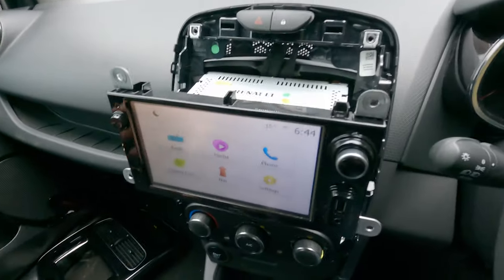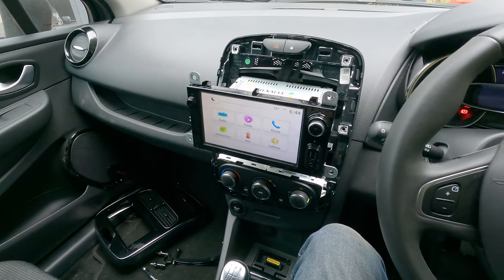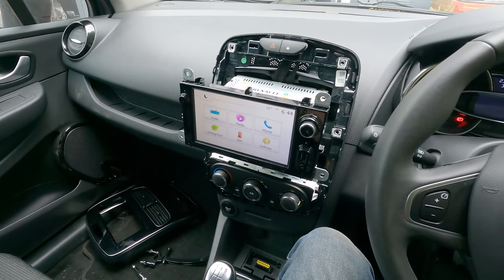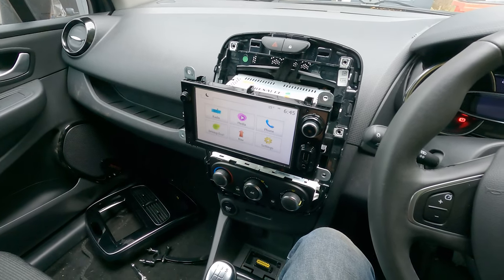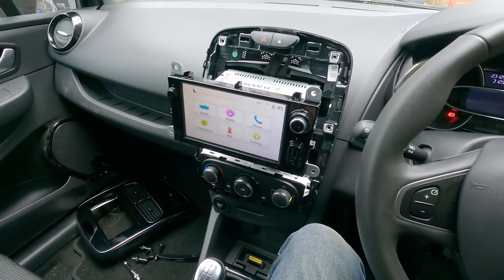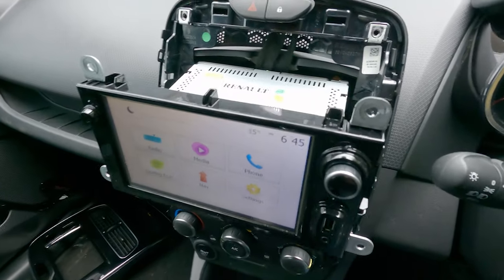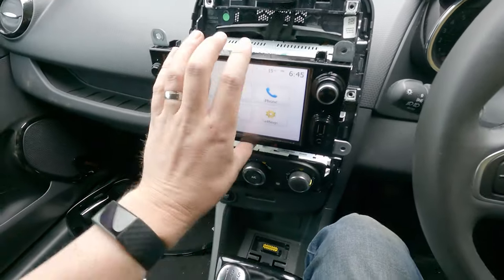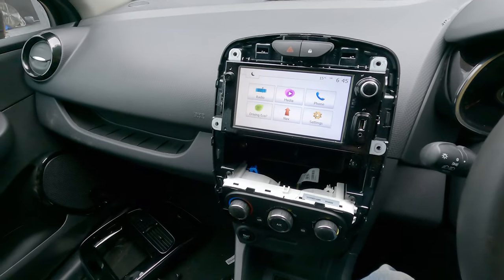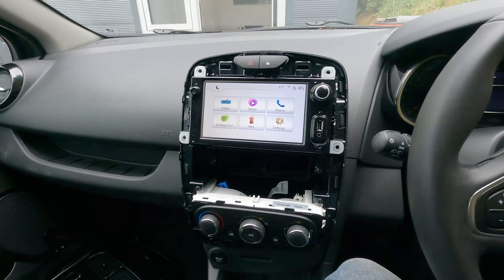Brilliant. So slightly annoying, had to pop the radio back out. There is an app and I will tag it in the description, and basically all you have to do is install the app, completely free, there are a few adverts with it. It's called Renault code generator. All you do is use the app, scan one of the barcodes on the top, and it automatically generates your code, as opposed to having to go to Renault on their website and pay £10 to get the code back. So yeah, brilliant. I'll tag that in the description.